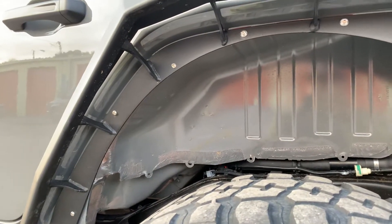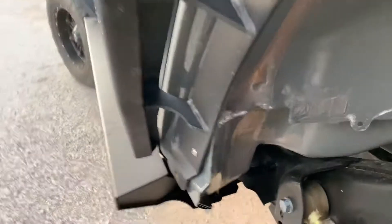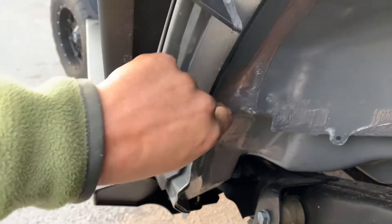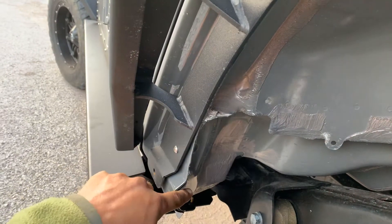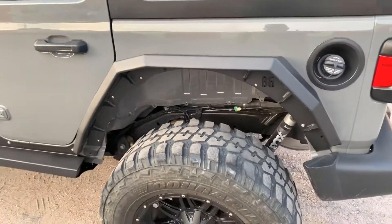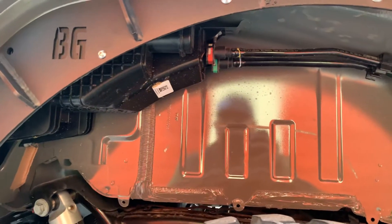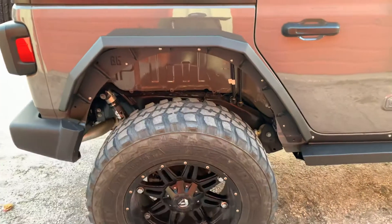These are fenders with inner fenders. This one was in there, but we had a heck of a time getting it in and getting it to line up. We actually had to cut away and grind this down for the tip to fit in here. After we got all that in, there was a final piece that attached with one bolt, and it was literally dangling and rattling and making a noise. We weren't happy with that. When we got to the other side, the inner fender didn't even fit — it wouldn't go in. I had about an inch and a half to two inches of space where it would not go. It was pushing lines up in here and shoving them to the side. I didn't want anything rubbing against these lines or shoving up against this box. It was very, very not form-fitting at all. So we are actually running without that as we work with Bodyguard to figure out a solution.